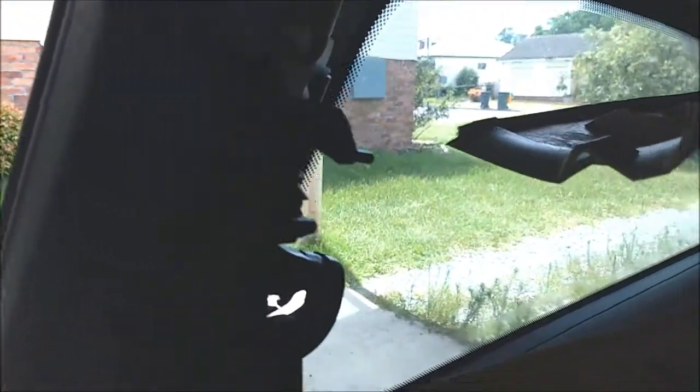The same applies for the B pillar trim - just pull it off. But when you go to reassemble it you have to watch out. Don't do what I did the first time. This one is actually missing a couple of little bits off the seat belt mount. You have to make sure that everything is realigned so that this little trim piece aligns with where the seat belt actually is at the time. Otherwise if you try and force it on there and those two aren't nicely lined up, you can see these little bits you need to clip onto those - you'll break something off.